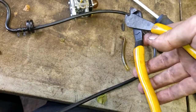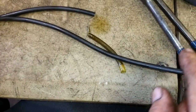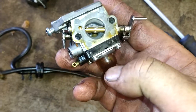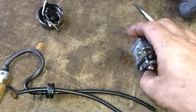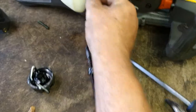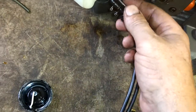Make sure you make it really long. Cut this one to a point as well and push it through the grommet — it just has to go through the grommet. I'm making this one longer so I know it's the return line. Remember: the top line closest to the fuel pump is the one that goes to the filter; the one near the primer ball is the return line. Go ahead and shove the filter into the gas tank, making sure it goes all the way to the back.